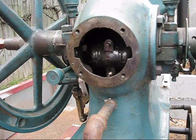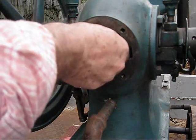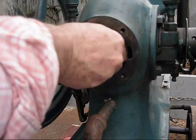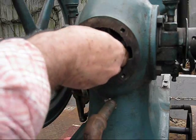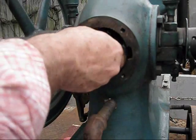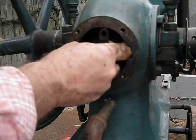A lot of these M's need this procedure done more often than it is. So if yours needs it, just go in and do it. Anyway, you work the rod cap off. You'd really like to have both hands up in there, and you want to get this thing off of there so your shims don't fall down in yonder. Sometimes you lose one.